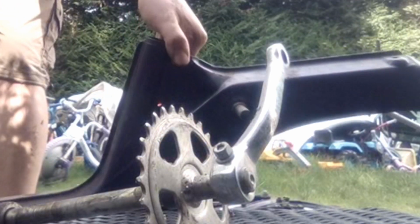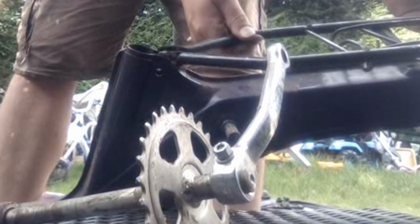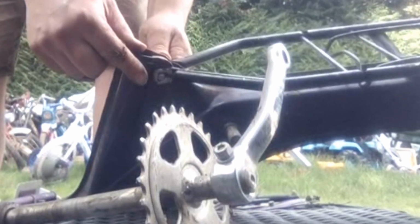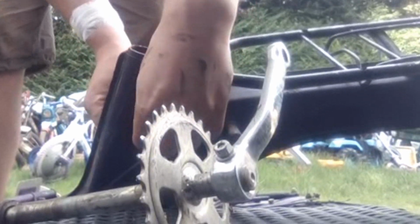So we're swapping bikes now. We're going to start assembling this one. I won't show you the whole process of assembling it, but we're starting off with the rear rack, if I can get it on, followed by the little spacer thing to stop you pinching the frame too tightly and bending it. Two nuts, top and bottom, the bottom one just basically holds the spacer in and keeps it clamped around the seat post.